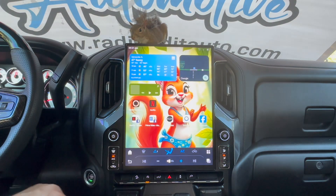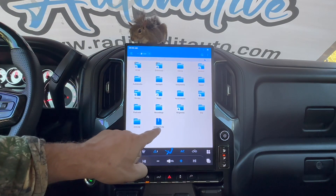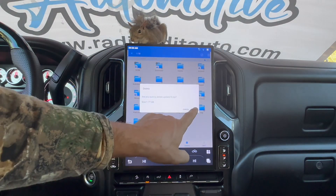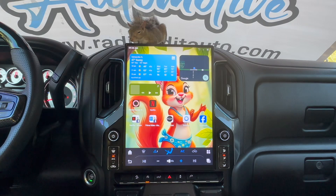Now we're going to want to go to Superfile and remove that update13.zip — so we delete it. The reason we're deleting it is that every time you go through a reboot, it would come back to that update screen over and over again. Once the update is done, you're going to want to get rid of that. At this point you will now be completely updated. As mentioned before, if this is not an AU car unit, I strongly suggest you don't try to do this — it could end up breaking your system, and if you bought from Amazon or eBay, you're probably not going to have the support to get it fixed.